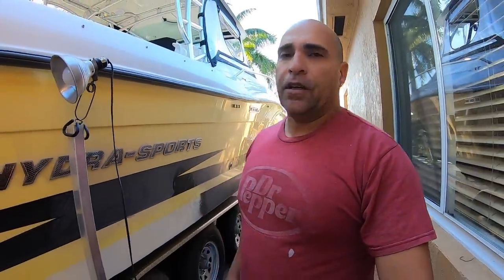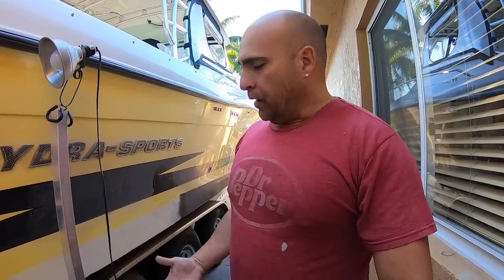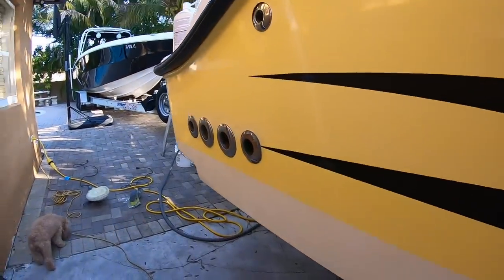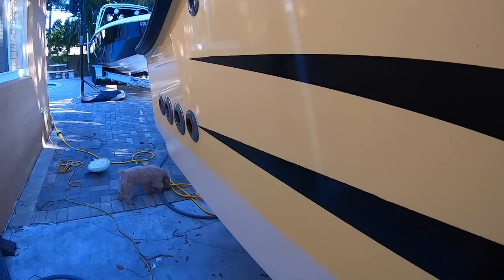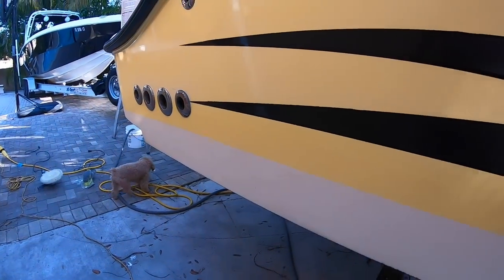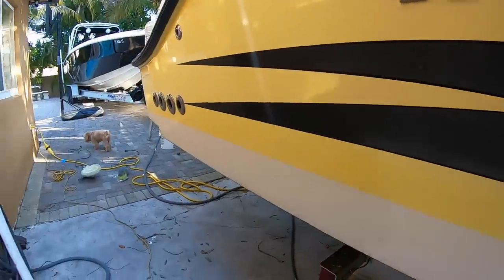I forgot to put on my mask. Yesterday when I started I got my nose full of dust, so I need to put on a rag or a mask — let me do that now. But you can see it's not that bad. That's the finished section right there — you can't tell the color difference. Once you sand up to 800 and apply rubbing compound, it matches in color. So it's going to be labor-intensive, but if you're not afraid of work and dust, you can do it yourself.